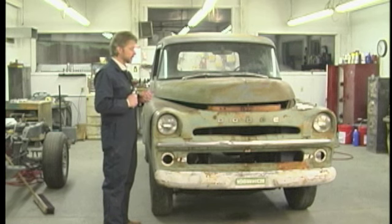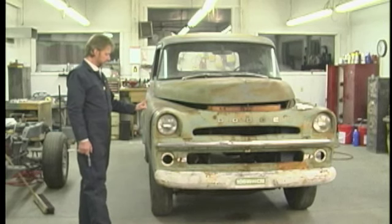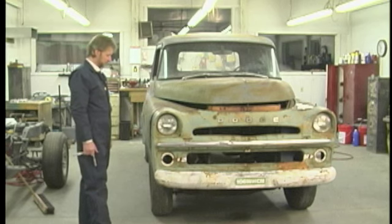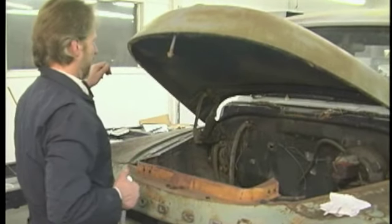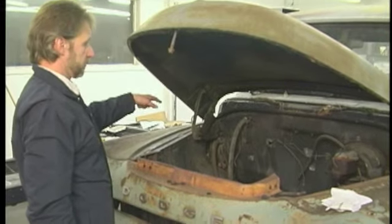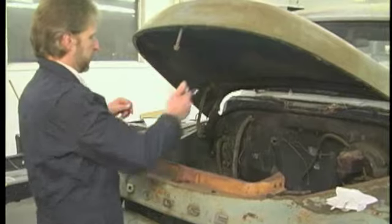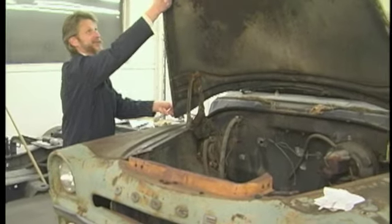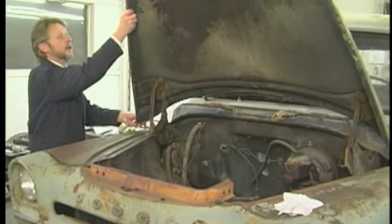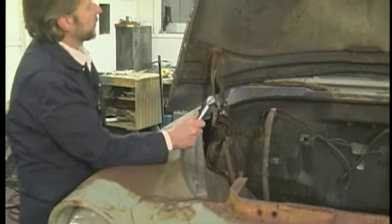The first thing we've got to do is get the hood off, then I'll start ripping the rest of the nose off. I'll probably replace this fender — the more I look at it, the more I realize it's pretty well shot. One of the cool things about these old Dodge trucks: '57 was the first year they had this alligator-style hood. Before that they had a butterfly style with a piece in the center. These hoods you can actually open straight up, which made it real easy to take the engine out.